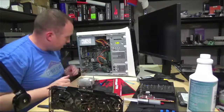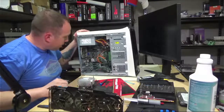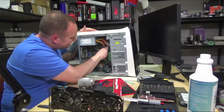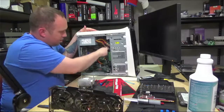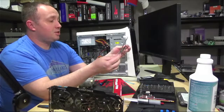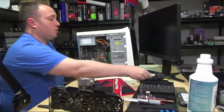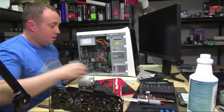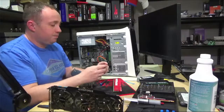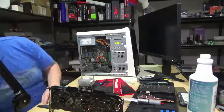Okay, oh yeah, that thermal paste is dead. Jim, he's dead. All right, so we're going to resurrect that. Boy, that is dry and crusty. I'm going to swap out this RAM. Let's get this RAM out of here. Okay, so we're losing 2 mismatched sticks of DDR3. These are 4 gigabytes each. So we're gonna get rid of those and get a matching set of some nicer RAM. I don't think that this motherboard's capable of even doing the XMP settings. So yeah, whatever.